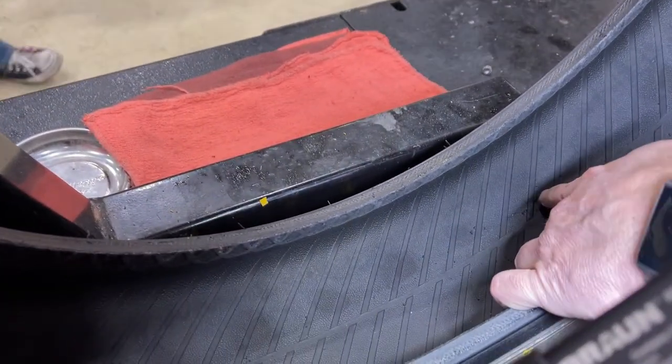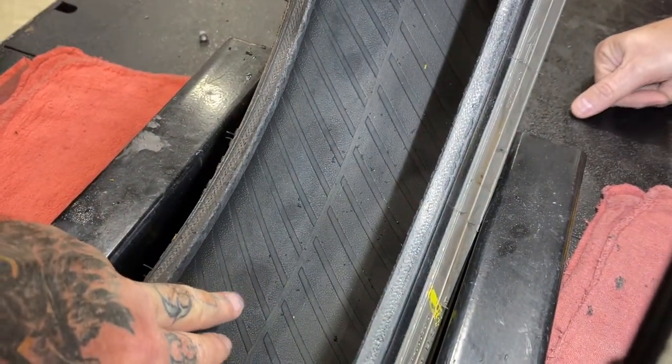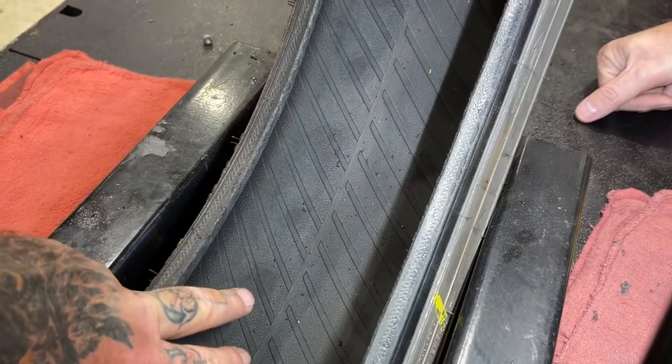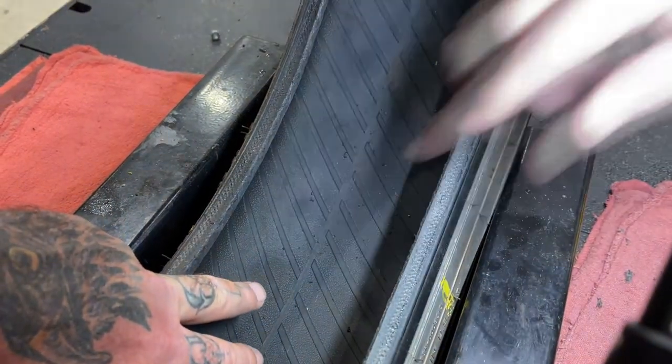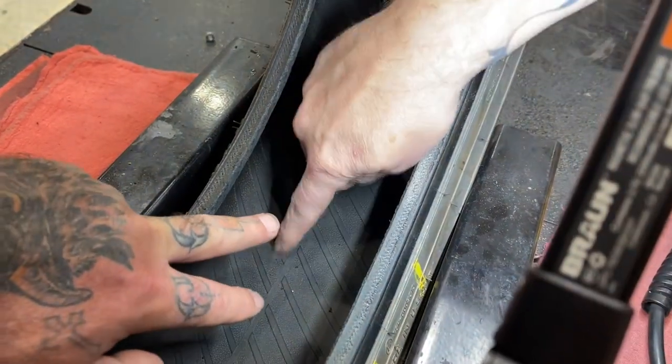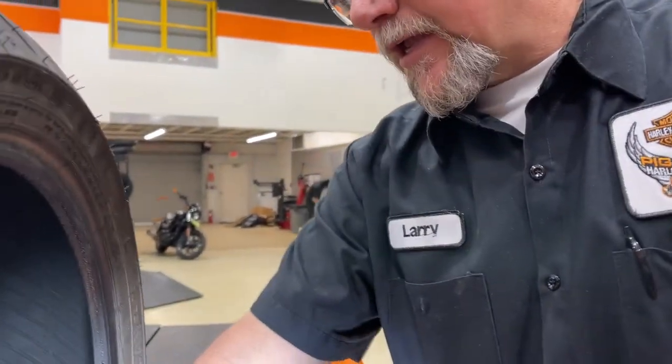Because that's starting to separate — it's every other one. What I'm hearing, Larry, is it's getting thin on the outside and it's causing heat, and that's gaining heat right there. Correct — that's because of the heat deposit right there. And you can see every peak and every low has got one. So eventually this tire would go — it's separating because of overheat. That's what it did.